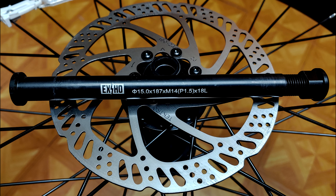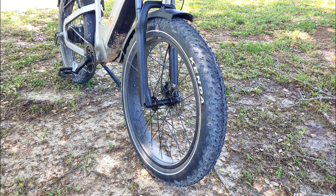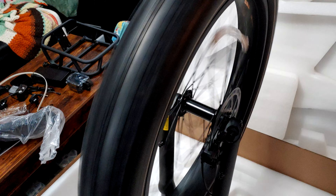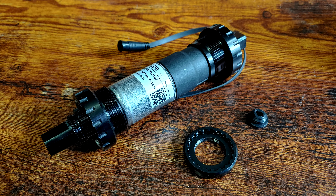So what is Freedare doing with their bikes to make them stand out? Well, to start with, you get a through axle on the front wheel — that's the first electric bike I've seen with an actual through axle. These are tougher, can stand up to more abuse by their very nature, have sealed bearings, are easier to remove and install, and all-round less headaches — built better.